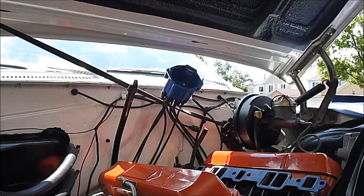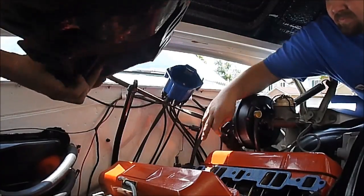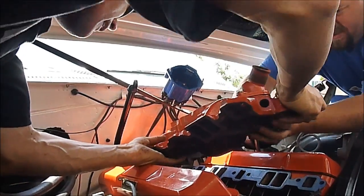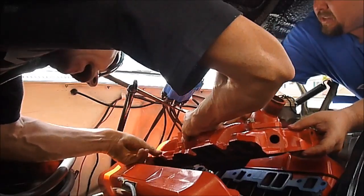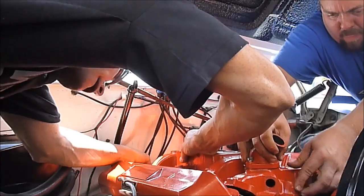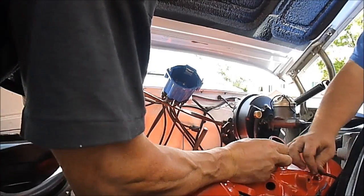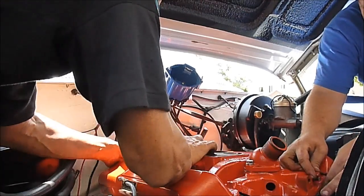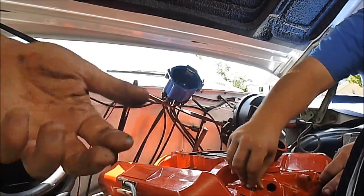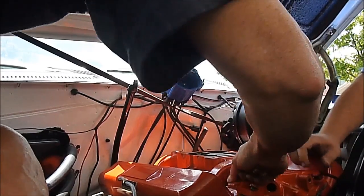I'm hoping that the thermostat housing gives us an extra handle. Here we go — putting the intake manifold back onto the car now. Let me get it from the port over here and slide it underneath. Drop her down. There we go — lined up. Let's get the bolts on this side. We have our long ones — I just want to get them lined up because we've got to put some sealant on. The Chevy angle on the bolts makes things interesting.